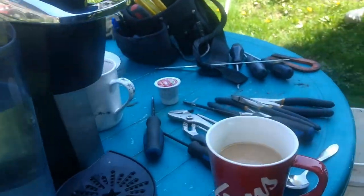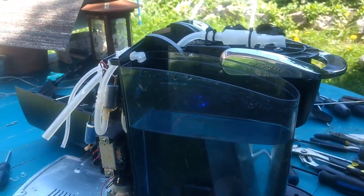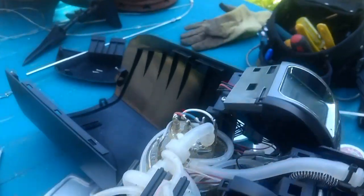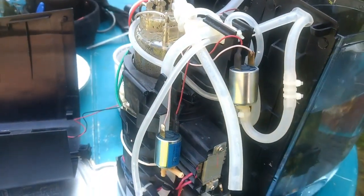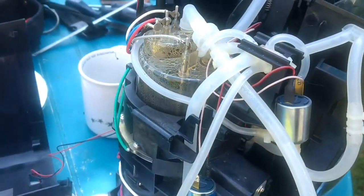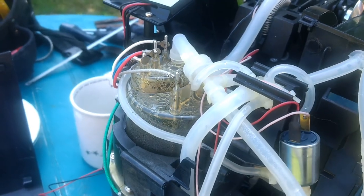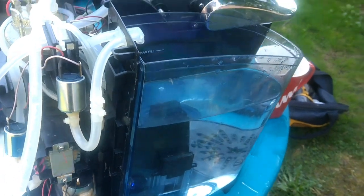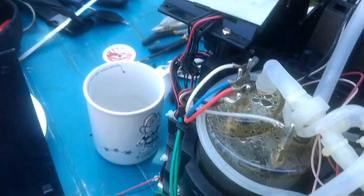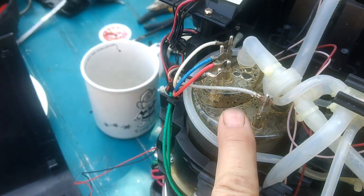I'm back enjoying my coffee. I have not got the spare solenoid from the other unit yet, but I wanted to clarify a couple of things — I made an error in the first part of the video. When you first turn on your machine and ask for coffee, the water pump under the tank draws water from the reservoir and pushes it up into the hot water heater.